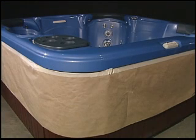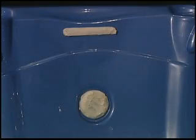Be sure to use high-quality tape and masking paper where necessary. Beware when machine polishing. Compound spray can be difficult to remove from deep crevices. When preparing the area to sand and polish, such as in spas and bathware, be sure to tape off and/or remove escutcheons, jets, overflow, skimmer, and/or cabinet areas that could come into contact with the sanding or the buffing process.